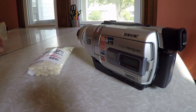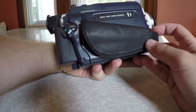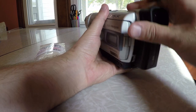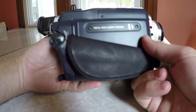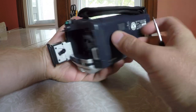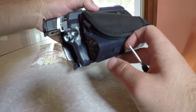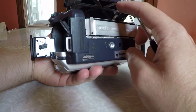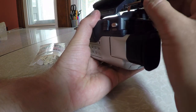I'm going to show you how I clean it on this camera — it's going to be the same for a lot of these models, so hopefully that clears up a lot of misconceptions. I'll start by popping the battery out. We don't need power to do any of this. I take off this entire side panel because once you remove it you get a really clear view of the video head, and it's a lot harder to do it any other way. There are several screws and I may fast forward through this part.